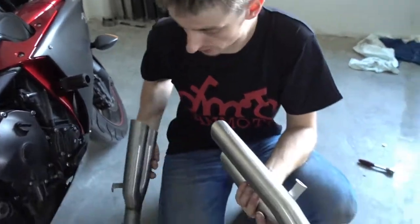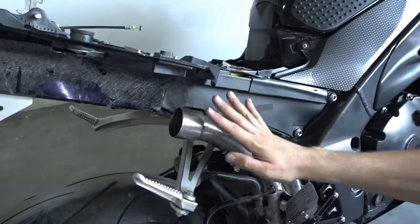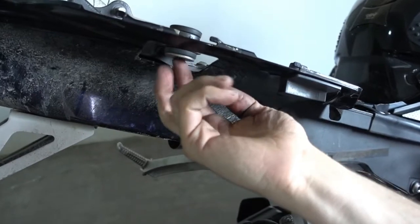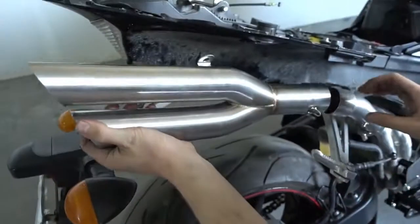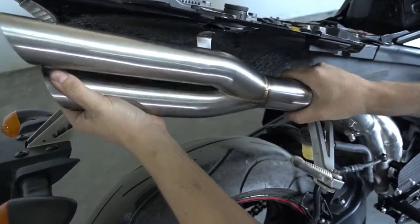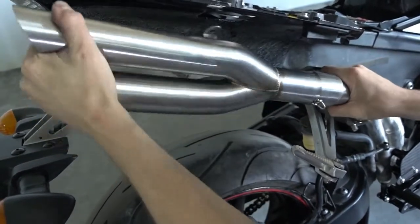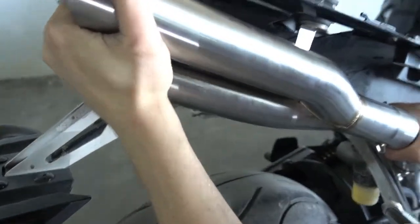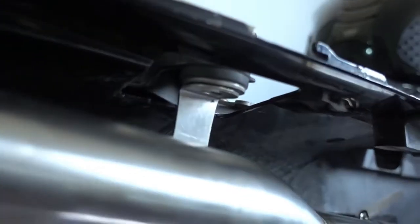These ones are really, really simple. The mid pipes mount just like before, no difference. But you see, I removed again this little bracket which was mounted here before, which we need for our carbon and titanium ones. So with the XG-1, you basically just slide it onto the mid pipe, and you align it with the original mounting point here. That's where the original exhaust mounted to.